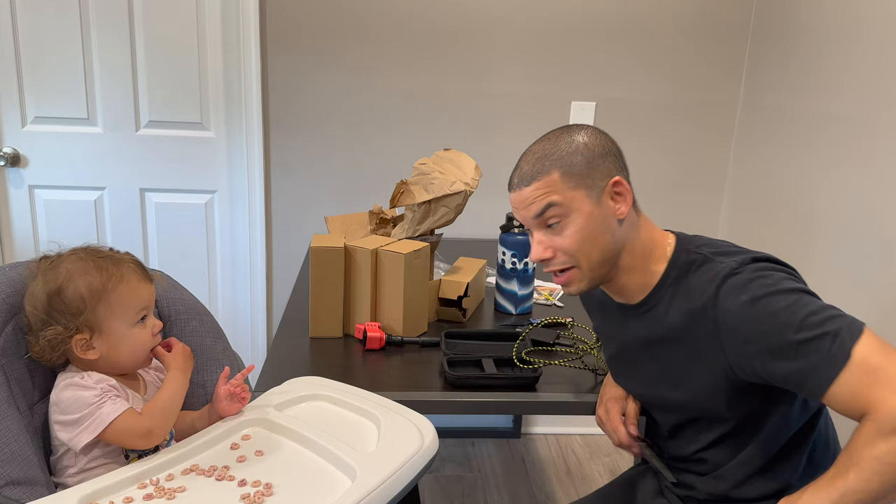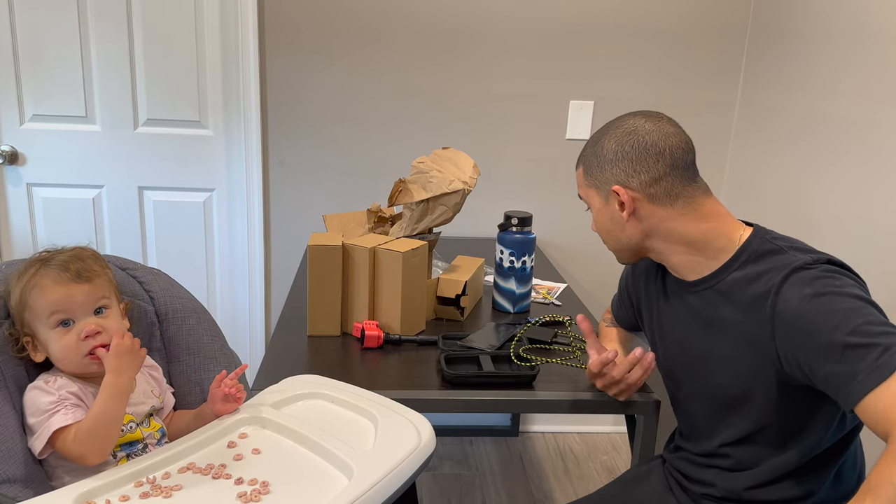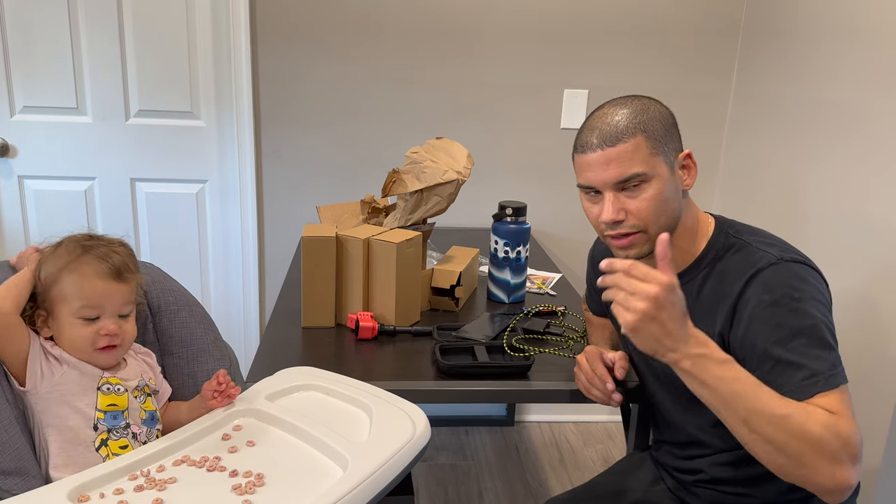Well that's all I got for now, guys. We're going to toss these coil packs in. At the very least, get the trans tuned tonight. And as soon as I know that my Racing Line tune is still technically a beta file that's on the server and I can flash back to it, we're going to flash the 034 software. We're going to go with 93 first, and then come the weekend, we'll flash the full E85 file. See how we like that.